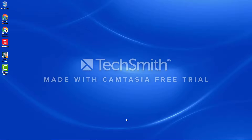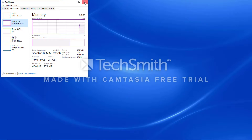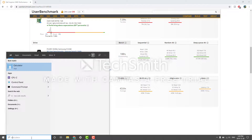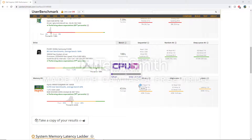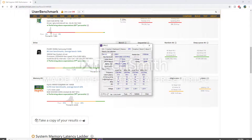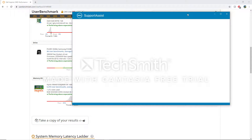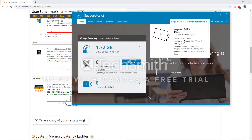There are many ways to check how much RAM is already installed on your system, the easiest being checking Task Manager. So over here you can see that there is 8 gigs installed. You can also check by running a benchmark test such as UserBenchmark to see exactly what type of RAM you have, or you can run CPU-Z and check the memory, and you can also open SupportAssist, which should come pre-installed with your Dell laptop or you could just install it from their website and then check over here.